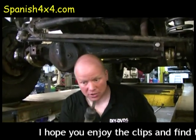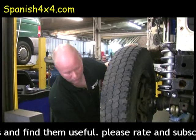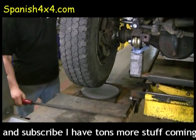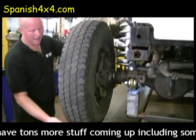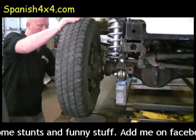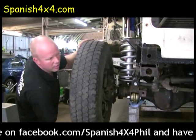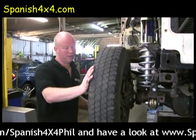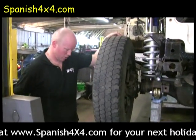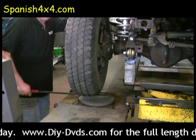Now we'll drop the ramp and show you the checks of the wheels. Grab the wheel and lift your wheel off the ground — you've only got to get it up far enough to get some form of lever under there. If you just rock it top to bottom and check for any movement or play, because the wheel bearing will affect your steering as well. And that's all tight.